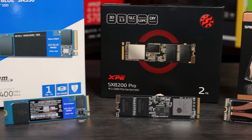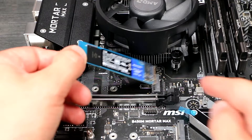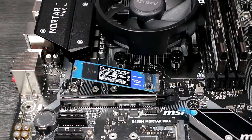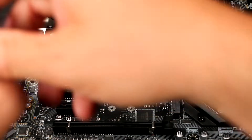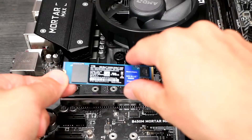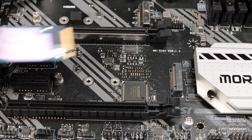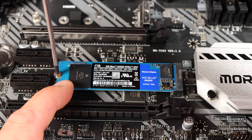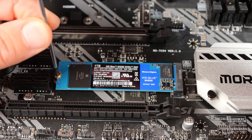Installing an M.2 drive. If you're installing an M.2 drive, now is the time to do that too — they're often obscured by the GPU once that's in. It's easier to work outside the case, as it's a fiddly job. Don't remove any stickers from the drive; they're metallicised and act as heat spreaders. Identify which slot you want to use — normally the one closest to the CPU is ideal for a primary drive, but check your manual. Then ensure the standoff is in the correct location. M.2 SSDs come in different lengths: 40, 80, or 110mm, denoted by the last digits of their form factor name. 80mm is becoming the standard, but line up the drive to check. Ensure the standoff is securely screwed down, but don't over-tighten it. Installing the drive is as simple as pushing the connector into the slot with the drive at an angle, then pushing it down so the tail end sits flush with the standoff. Use the world's smallest screw to hold it into place, and you're done. If you have an M.2 heatsink, refit them now.